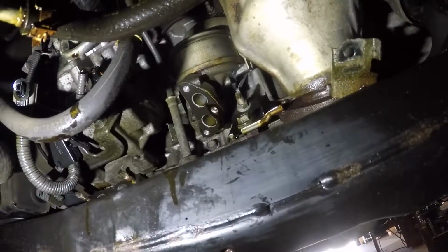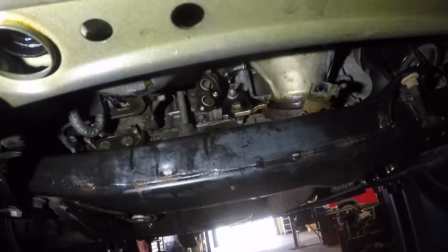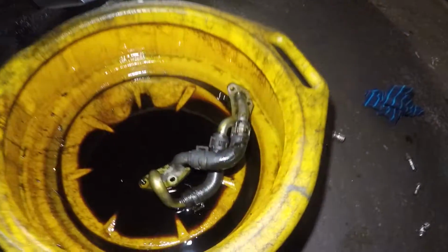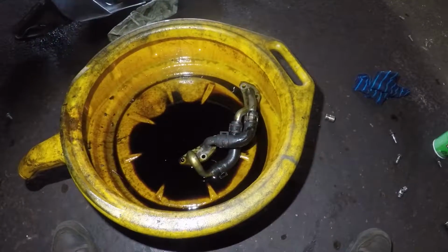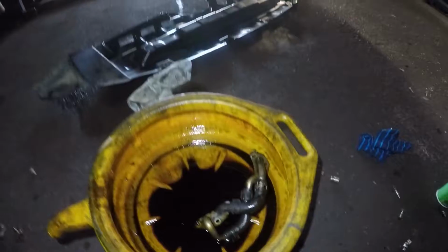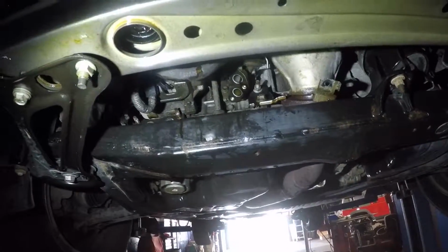So there we have it. We're going to let the oil drip, and when I get the new part, I'll show you guys. But anyways, if you have a leak, that's what it is right there. And the new pipe is going to be all metal, and that's going to take care of a lot of things, so it won't happen in the future again. Also remove this little number 10 bolt, which is right up here, that's holding that.